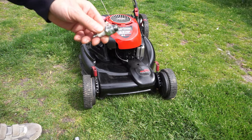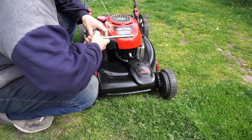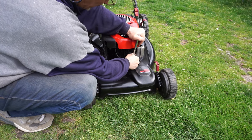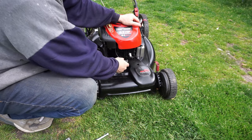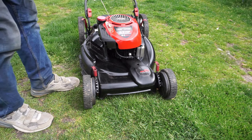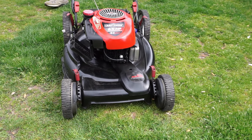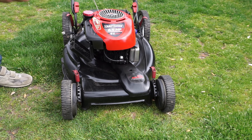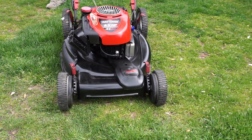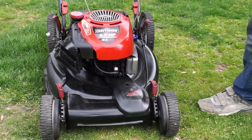The end of the plug looks good. I've got a nice new plug — let's put that in. For the money these customers are paying, sometimes you've got to replace parts. A tune-up shop charges around $125, and a tune-up is not a repair. After installing the new plug and giving it a pull with some starting fluid, it still won't start. Most likely it's not sparking — most likely it's the coil.